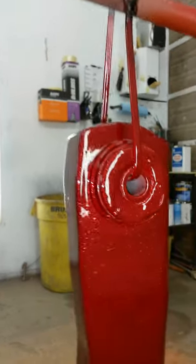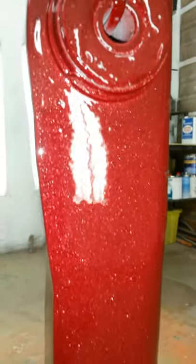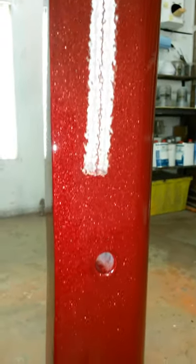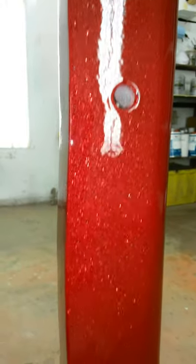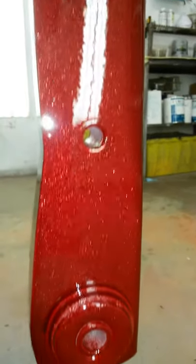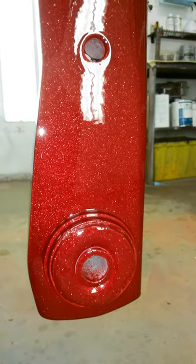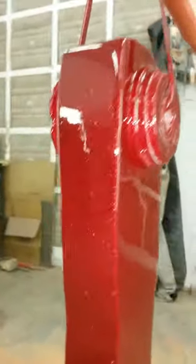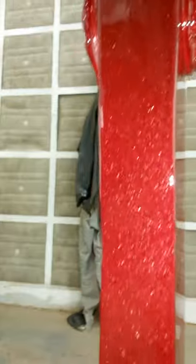The arms are painted and the trailing arms are too. Brought them to work, used some Rust-Oleum primer — eight bucks a quart — used it as a white base primer, put two good wet coats on. Used 320 to sand it down smooth, and I even used some glazing putty on this too — Evercoat glazing putty — before I primed these up, just to give them a smoother texture. These are done.